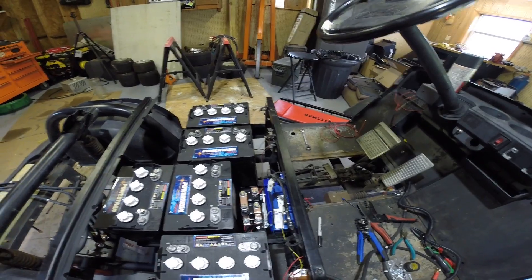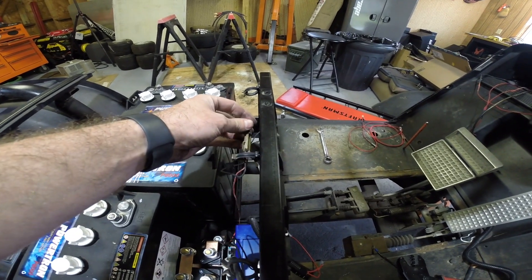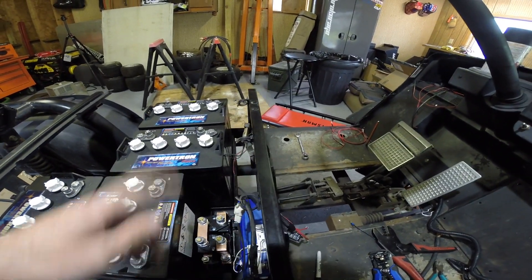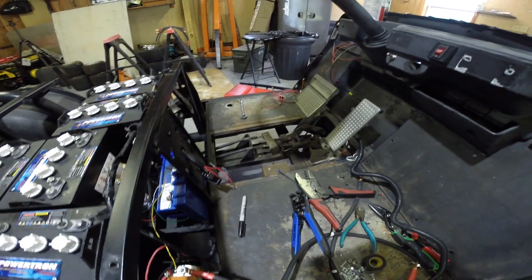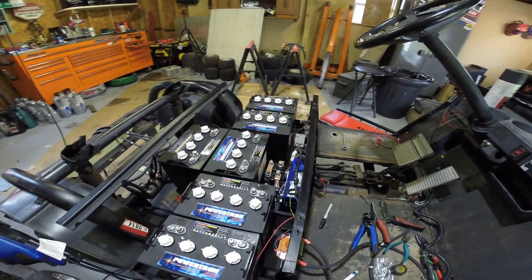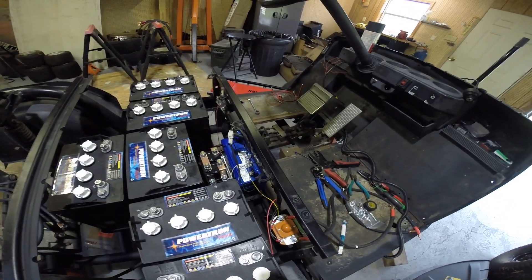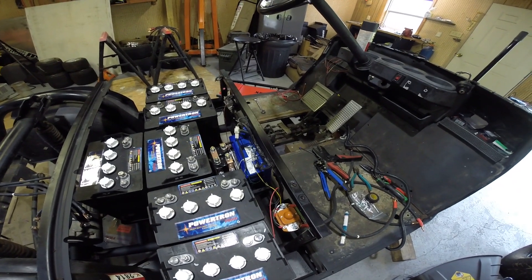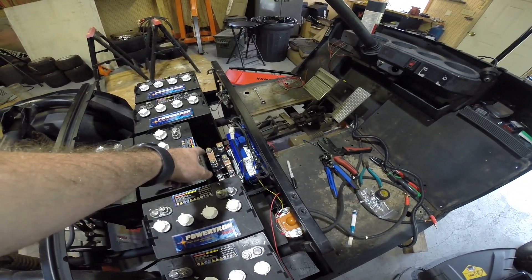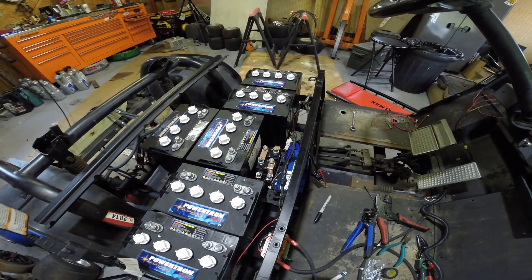I haven't figured out the charger yet — I'll film how I wire the charger once I figure that out. There are some old diodes or fuses on this cart that are pretty janky, so I'll have to get those replaced. I'll post some links in the description with the Alltrax diagram. It's a little confusing because there are three or four different diagrams, since we're not just replacing the controller — we're replacing both your forward-reverse controller and the solenoid, so there are a lot of additional wires and wires that aren't used.